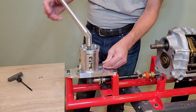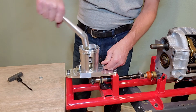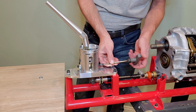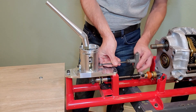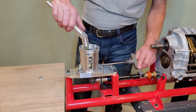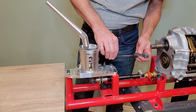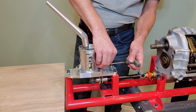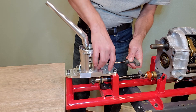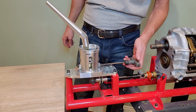For the front stop, just the opposite: move the shifter into an aft gear, turn the stop until it just touches, back off a little bit, then tighten down the nut while holding the allen wrench with a wrench.